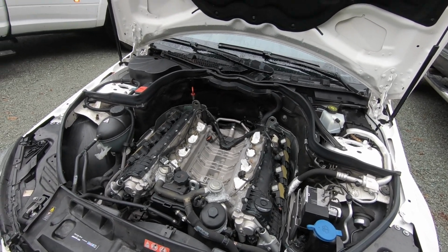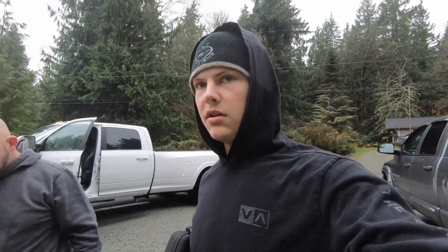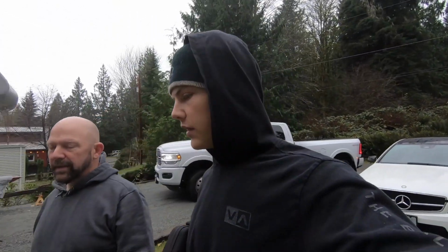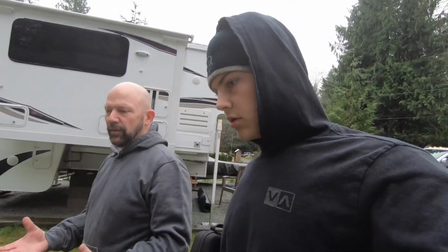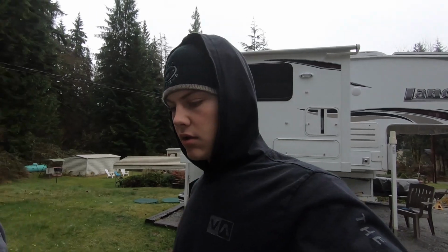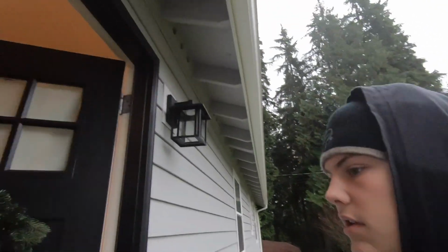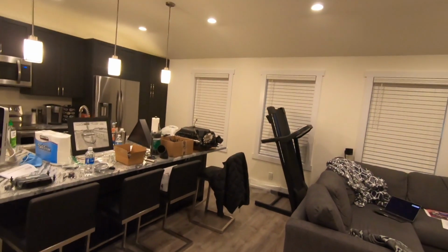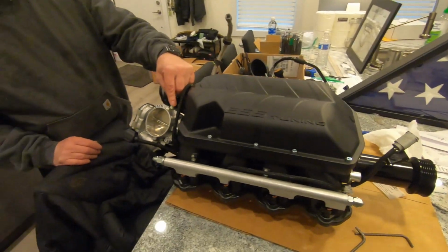I did a lot of prepping on the supercharger. You took the old throttle bodies off and installed them into the supercharger. The old throttle bodies and fuel rails on the stock one are actually inside the intake manifold. It is a pain in the butt. And then you installed fuel rails too? Yeah. Throttle bodies had to get tapped and plugged.